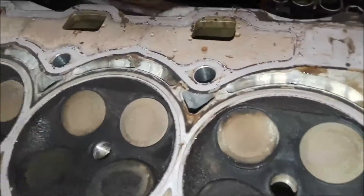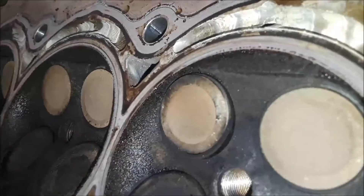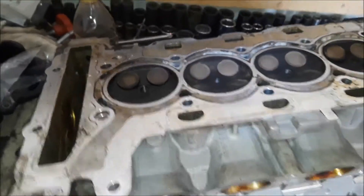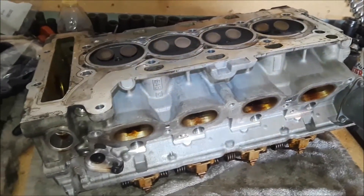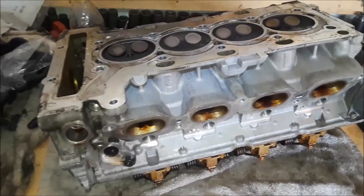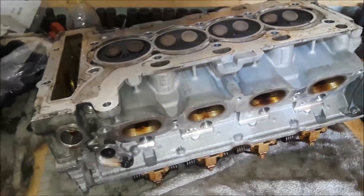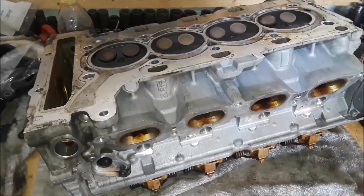The complete dismantling is done. I've definitely found the issue: a blown head gasket, clogged water ports, and a dislodged valve seat on the exhaust side. Imagine trying to fire that cylinder — combustion gases seep out through the holes in that valve. This concludes part two of my Mini Cooper restoration. Stay tuned for part three where I'll dismantle and rebuild the head, have extensive machine work done — check for cracks, resurface it, reseat that valve seat, and have everything else checked out. Thank you for watching Cobra Vids.